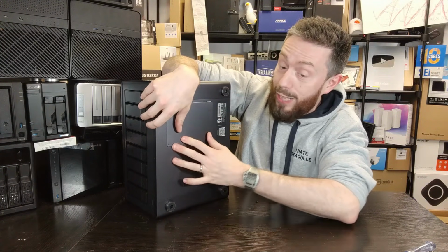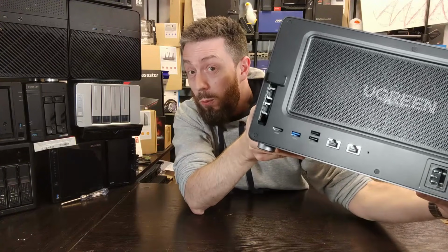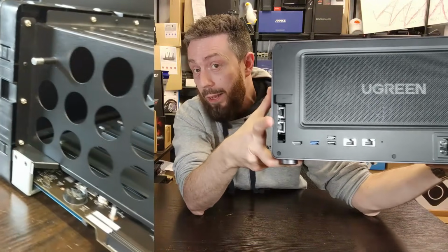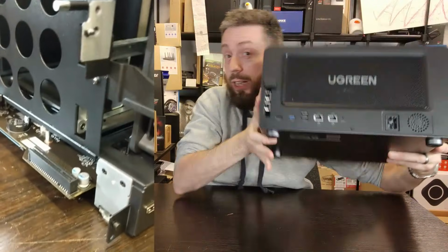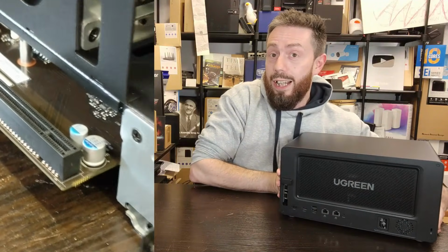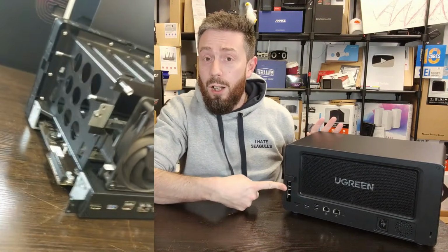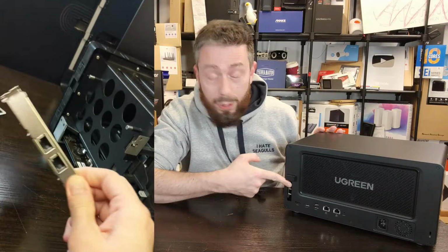But what about those network ports? The system has 2 10 gigabit Ethernet ports there on the rear. It's got a bit more USB, and as mentioned, a PCIe upgrade slot. You can go ahead and slam in pretty much anything. That is a standard X540T2 Intel upgrade card there, what I picked up on AliExpress for like 45 quid.